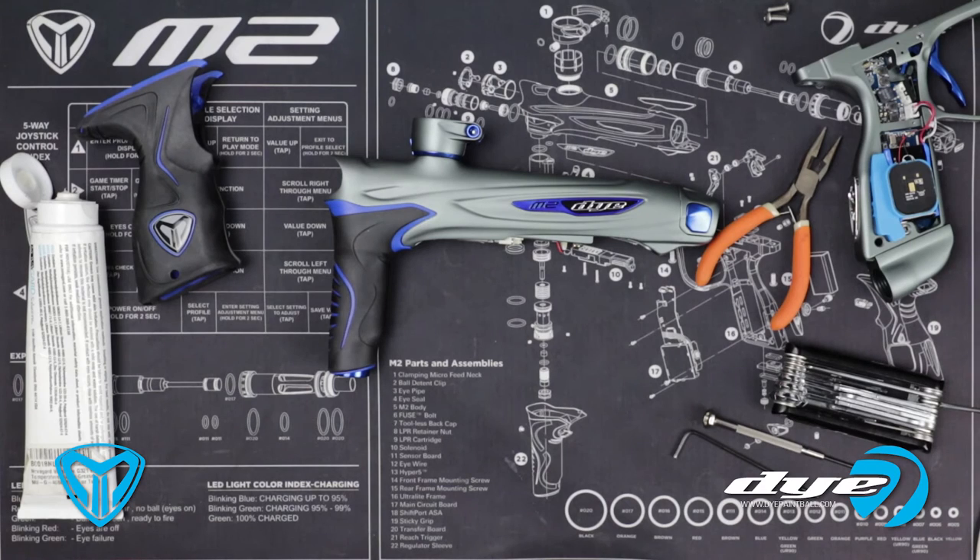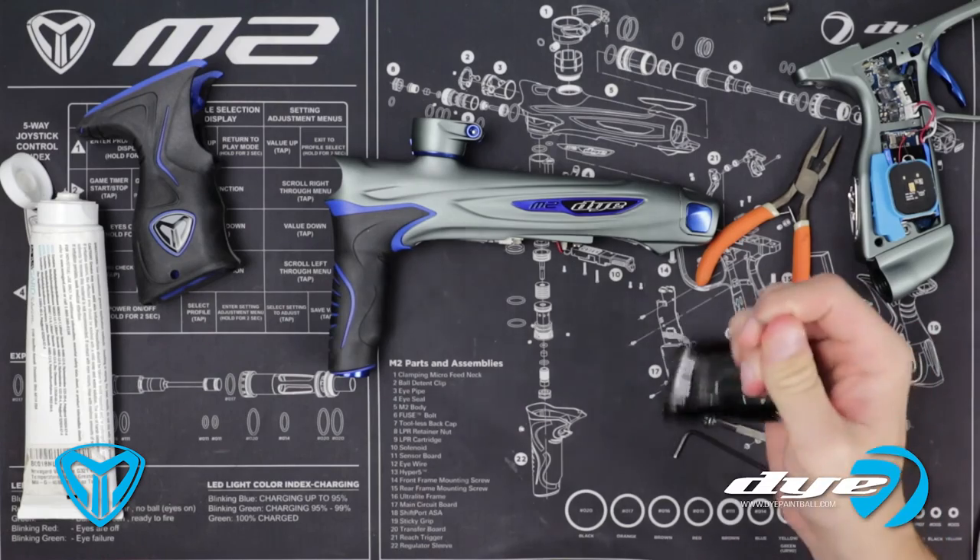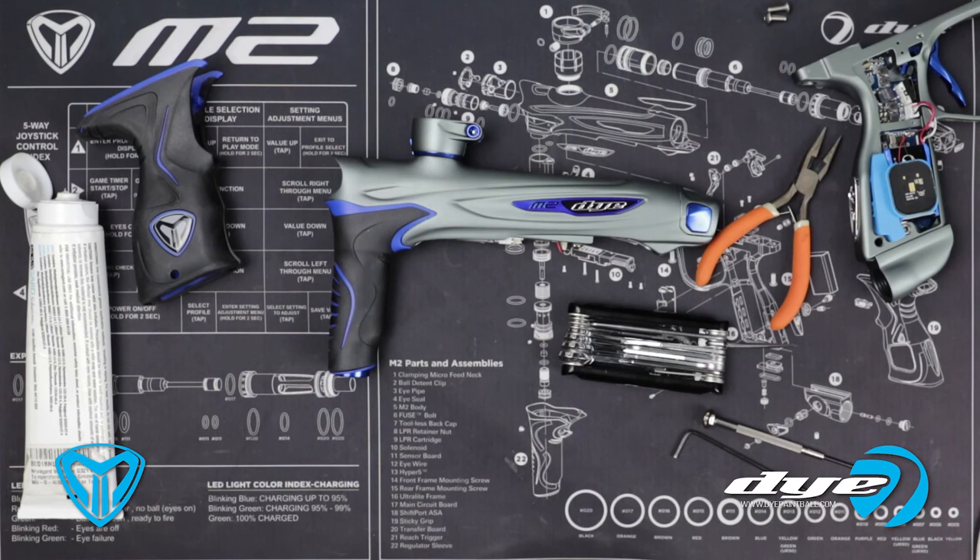There you guys have it. The solenoid is pretty much simple — the most simple thing on this gun, other than programming it. Again, you don't want to mess up any of the O-rings, so use caution when taking it apart. Use a toothpick and not an actual metal pick, because the solenoid itself is aluminum while your pick is most likely stainless steel or harder metal, and it could scratch it. Take things slow, clean it out, put it back together. Lube all the little gaskets and O-rings for added protection against leaking. Tighten one screw at a time — get it snug, you don't need to get it too tight. I hope you guys enjoyed and found this informational. Thank you for watching.